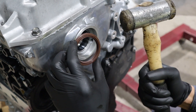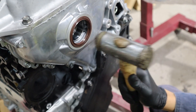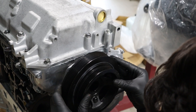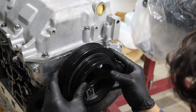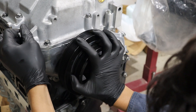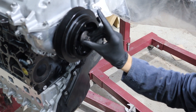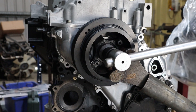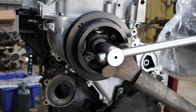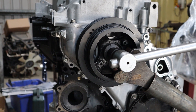Install the oil pump lip seal using a nylon hammer. Apply grease to the lip seal. Install the harmonic balancer pulley, lining the pulley up with the gears and the woodruff key before tapping it on. Apply grease to the thread and the head of the crank bolt. To tighten the crank bolt, you'll need something to lock the crank — use a harmonic balancer locking bar — then torque to 75 newton metres and an extra 120 degrees.